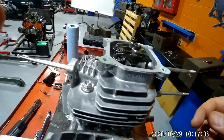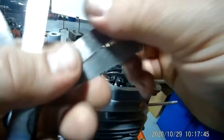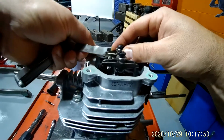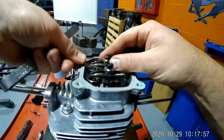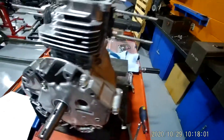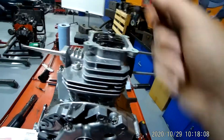Now I'm going to recheck. Take my six thousandths — okay, it won't fit in there. I'll try five thousandths — nope, barely. Four thousandths — all right, four thousandths fits in there. So I'm going to say that's good. If I couldn't get my four thousandths in — let's say only two thousandths fit — I'd have to loosen this nut up and try it again.